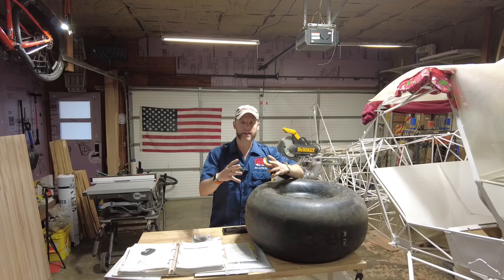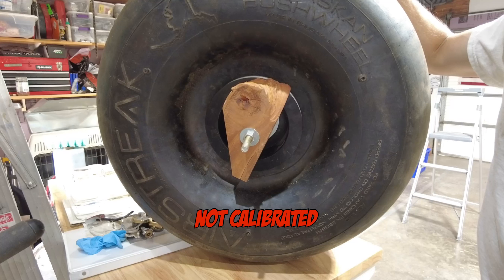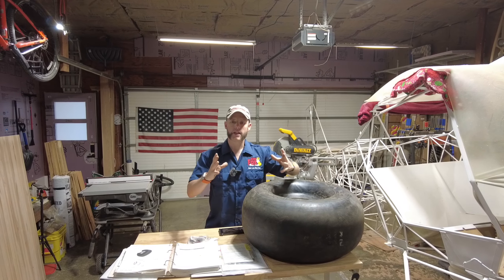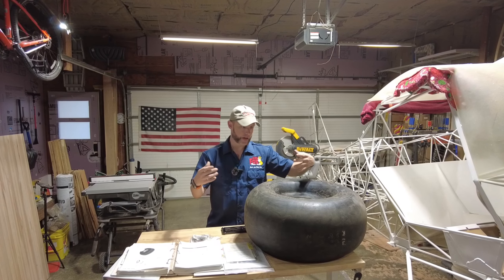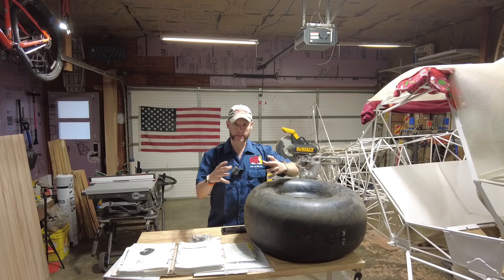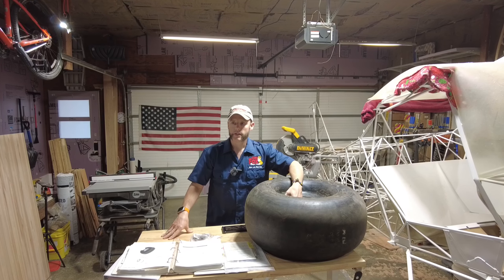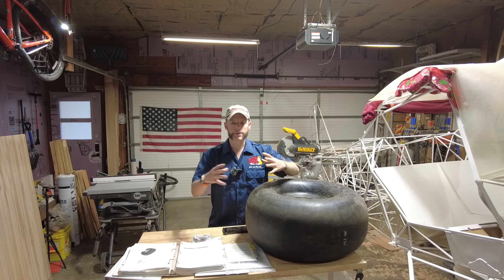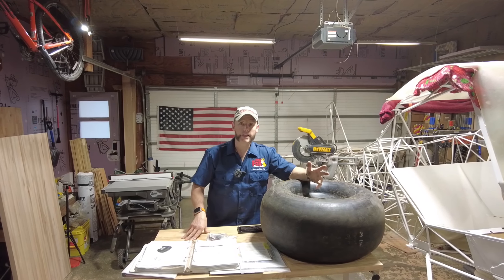If I couldn't get it popped into that concave portion, I used that long eye bolt with my makeshift wooden washers and nuts to pull it together gently, using more force than I could with my hands. I could hear the two rims pop into that concave portion of the tire. On the first one I could definitely hear the metal-to-metal contact, so I would know the rims themselves are touching each other with no tube in between because I could hear them clanking together.